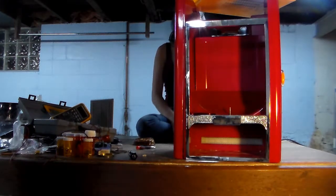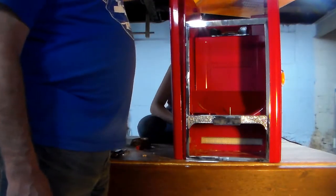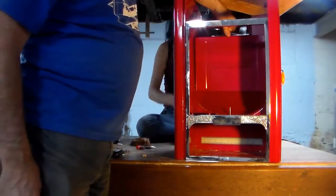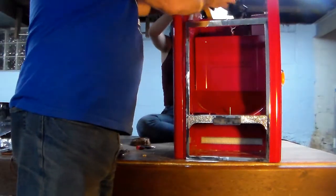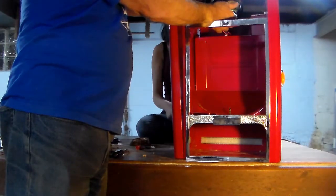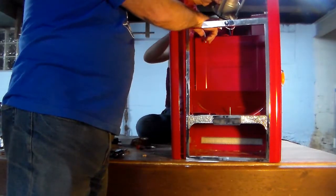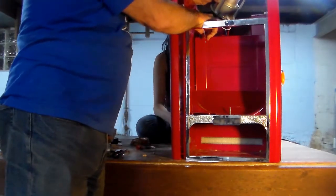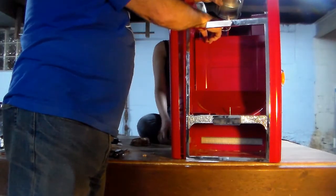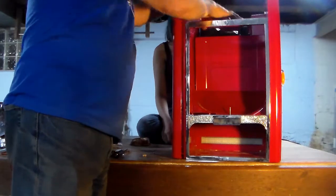After taking every screw you could ever imagine — and even some you didn't think you could find — it looks like we're ready to get this side panel off. This top panel has wires going through it, but only for a light. Inside here is the actual heater motor. To the best of my knowledge, it runs on 110 volts coming in, and then there looks like possibly a full-wave rectifier — full diodes and some transformers, though they're under glue and you can't really see them. The motor runs on 24 volts, and there's a power supply capacitor rated at 110 volts up here, like one of those XY caps. I checked and had no voltage up to it, so that made me think the problem is in the circuit board behind the switch.